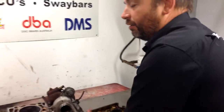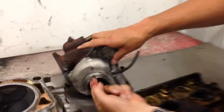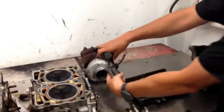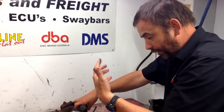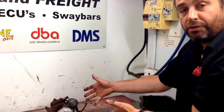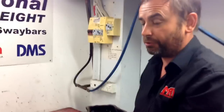Ultimately, this engine needs a massive overhaul — it needs a new radiator, the heater fixed, all the radiator hoses, and the turbo. You can see on the inside here, this is again caused by oil blow-by, because part of the return line from the rocker cover assembly goes into the inlet pipe for re-combustion of the crankcase blow-by. This builds up all this horrible sooty black scum, which has contributed to a really badly worn turbo. It hasn't failed, but the car is certainly not performing anywhere near as well as it could.